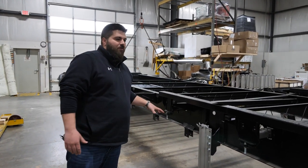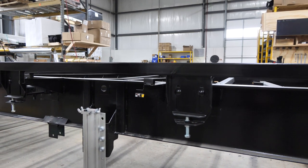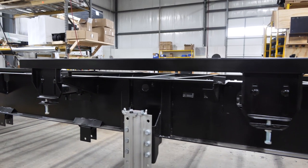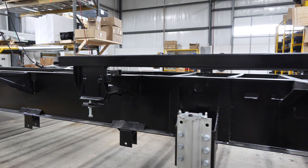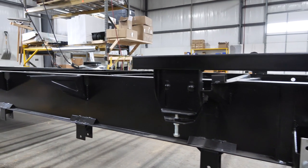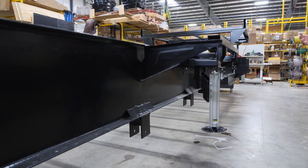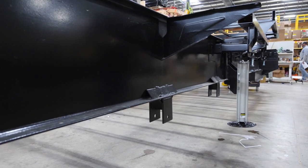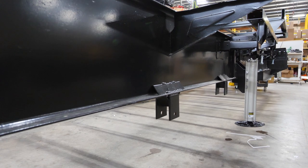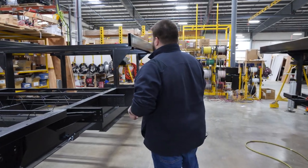We start with a 12-inch I-beam frame. A lot of guys are going to use a 10-inch I-beam, and you'll see a 15-inch stacked steel frame out there from some competitors. Structural I-beam is going to be the strongest. The reason you have to go 15-inch on tube is the tube is not as strong — it's an easier frame to build, but we don't feel it's as good a frame to hold up for the consumer. We've gone as far as adding gussets in your axle hangers to strengthen that area up, and we try to stay ahead of what other people are doing.